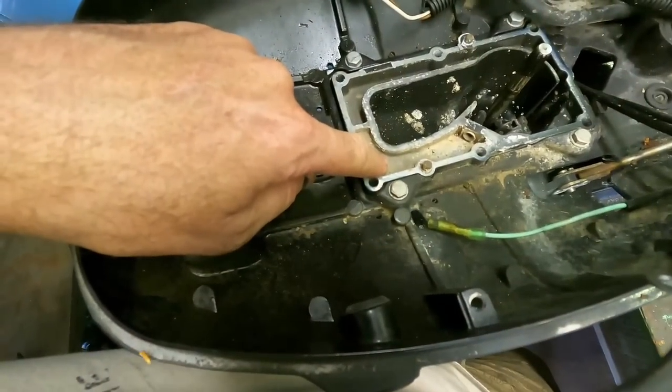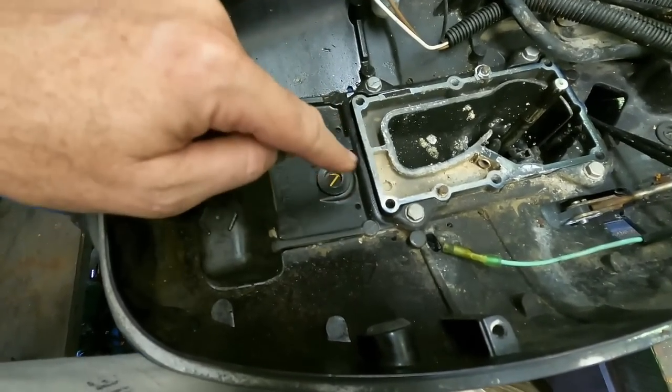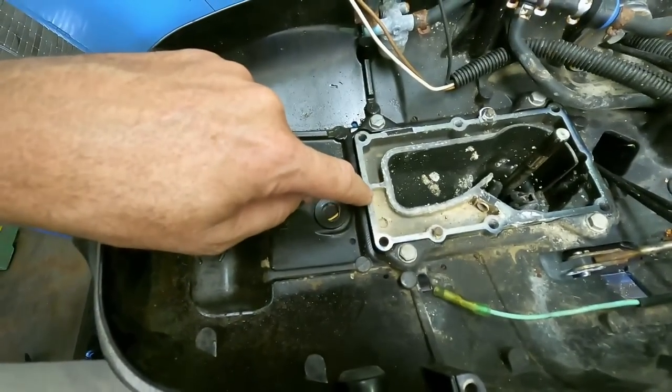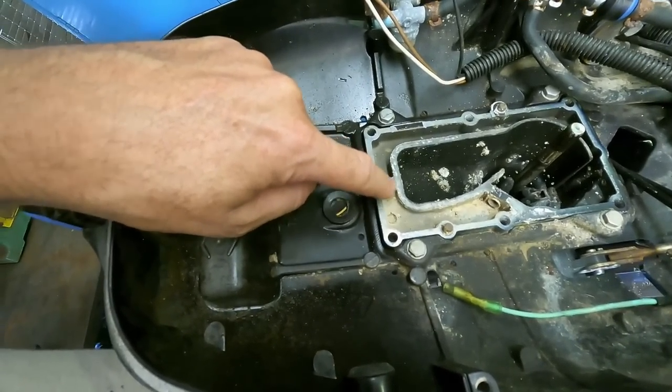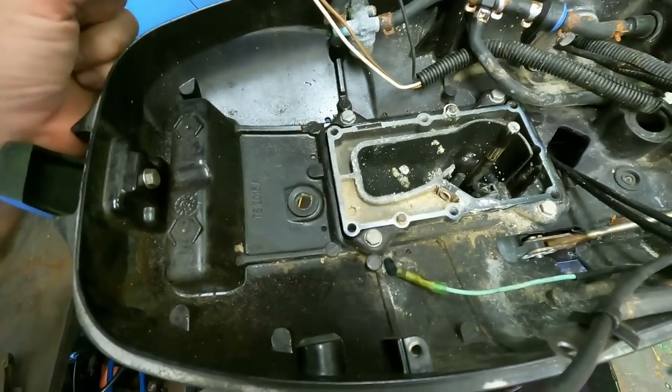In part one, a lot of people commented about cooling the exhaust. My real plan — which is much easier with a bigger outboard — is to actually do a dry exhaust up instead of going down the leg. What I'm going to do with the exhaust on this outboard is relatively straightforward. This is where the water comes in, then normally goes up into the whole midsection. All I'm going to do is get the Dremel, cut this bridge between these two sections, let it come up and down here, cool the exhaust — job done.